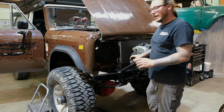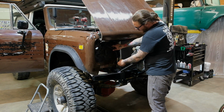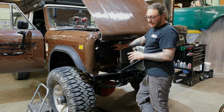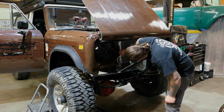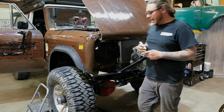Now, as I'm roughing in these hoses, one thing to keep in mind as you're fitting all these up, especially if a fitting doesn't have a straight on one end, you really have to pay attention to how the fitting is rotated. So as you're making them, it's a good idea to take a paint marker and put a little reference mark on the fitting and the hose itself.